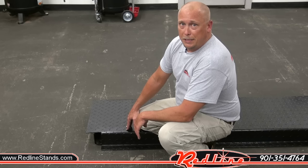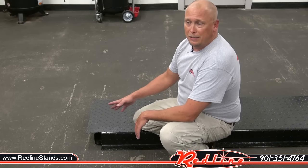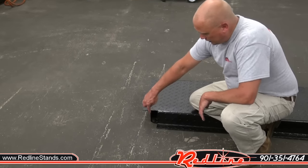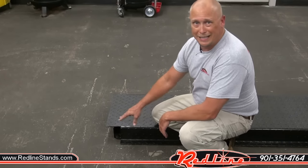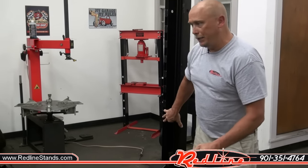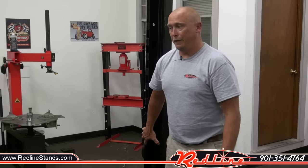Now that we have the H-frame set up and in place, the fun part comes — we're going to go ahead and install the runways. We're going to start with the passenger side runway, and the reason for that is it doesn't have the heavy hydraulic cylinder underneath it. It makes a lot more sense to negotiate this lighter one first, get it bolted into place, and secure everything up. One thing you always want to make sure is that you've got this lip pointed towards the inside. You've got this ledge in your overhang — measure from the front to the rear. For this installation it's 156 inches. Over here on our H-frame, we want the distance set correctly so we're not trying to struggle with these heavy runways and move the H-frames too. At the inside H mark is where you're going to want to measure 156 inches to the rear one, and that way you can just set your runways over, bolt it all together, and have a sturdy frame.